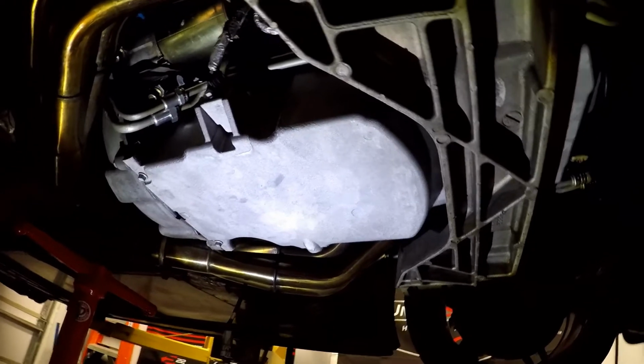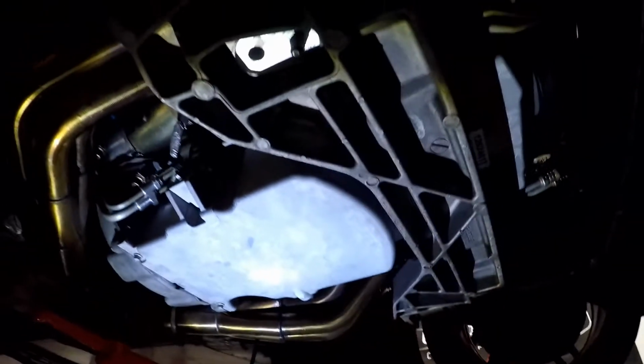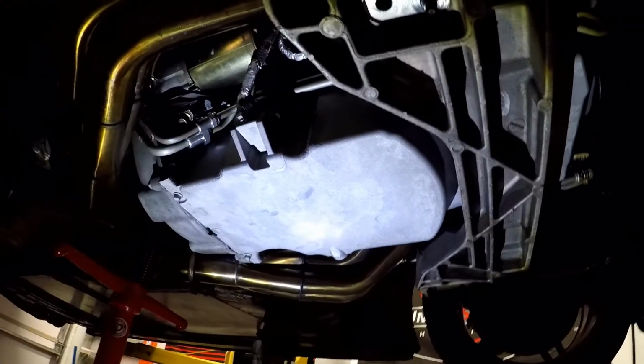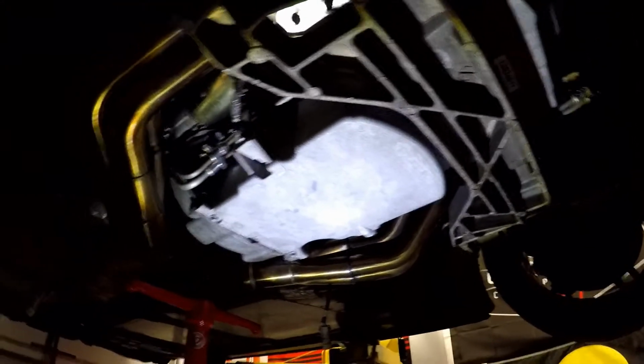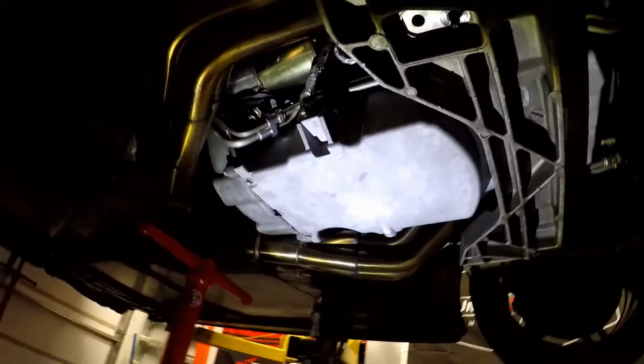One word of advice I'm going to say is take the bolts off the subframe. There's one here, there's one here, the 4 bolts for the front subframe. Take the rears totally out, the front, leave it till it's on its last thread, and you should be able to get enough room with the oil pan and getting it up and over the cross member of the subframe.